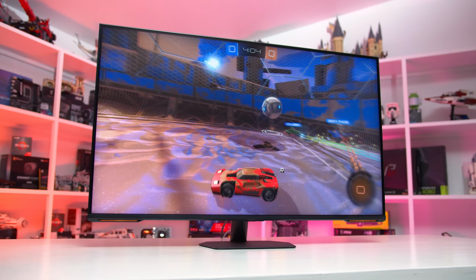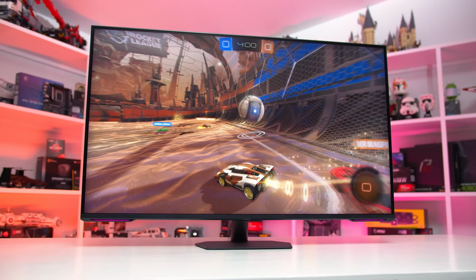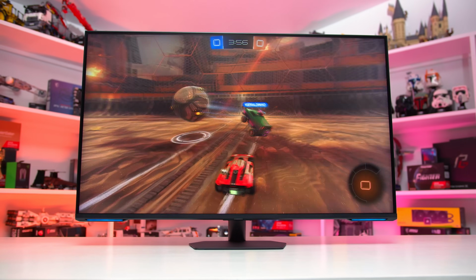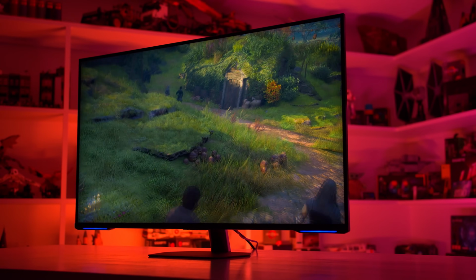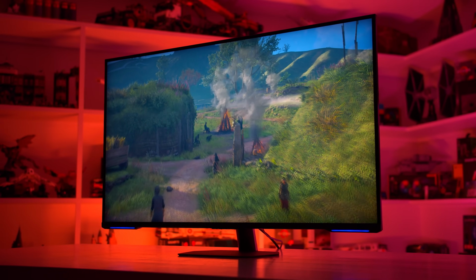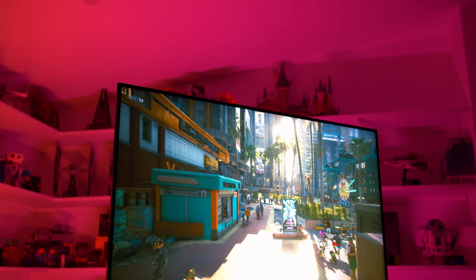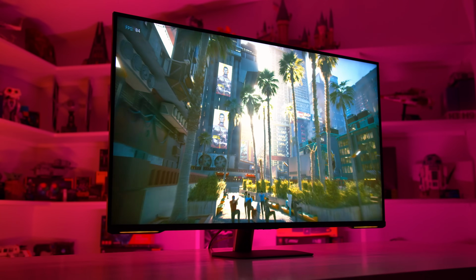The biggest issue with the LS43 is this being called a gaming monitor. I say that because despite offering a 4K resolution and 144Hz refresh rate, actual motion performance is awful. We're getting all the classic VA LCD issues: dark level smearing, painfully slow response times, low refresh compliance, and poor tuning. Visually, ghosting and smearing is quite obvious in any sort of fast motion, and put next to a similarly sized OLED, it's just a complete destruction of this LCD.